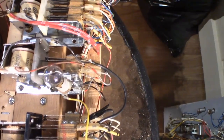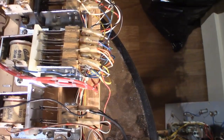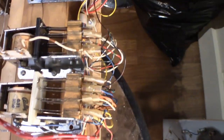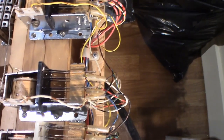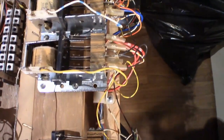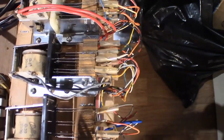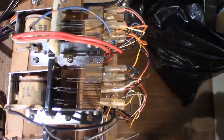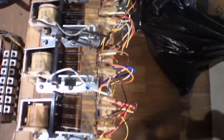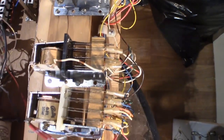Rest of these, pretty straightforward with just cleaning the switches. I used a Q-tip first, get off all the oil, and then basically a flex file, sometimes an ignition file depending if it was a high voltage contact. A few wires popped up, had to do some soldering on them, popped off I mean. And then no big deal.